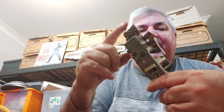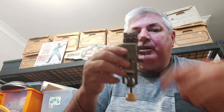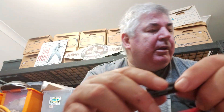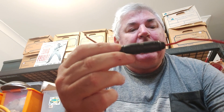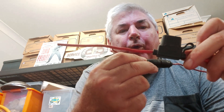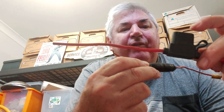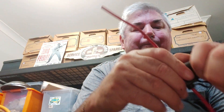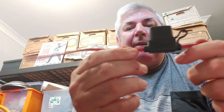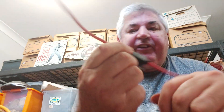Whenever you're taking an accessory to power, you need an inline fuse. It's just a matter of chop that — there's your inline fuse. There are inline fuses of all different types: you've got that type, you've got others, you can even get waterproof ones. That's one type of waterproof one for a cylindrical fuse, and that's the new type for your new types of fuses. If you just open it, you can see there's a new fuse in there. I'm a great believer in putting an inline fuse on every appliance, just in case.